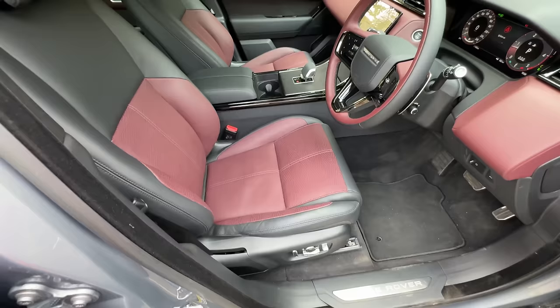Let's start driving. Air conditioning off, seat ventilation off. I get into dynamic mode, turn off traction control, get into drive, change the info panel to map view. Here is the full map view. Earlier they had a rotary dial to get into the various drive modes but now it's a lot more complex. Left foot on the brake, right foot on the accelerator, revving the motor to 3000 RPM. Even with traction control off, there is no wheel spin because it is a 4-wheel drive system. In dynamic mode, power goes more to the rear to make it slightly more sporty, but this car has quite a lot of understeer.